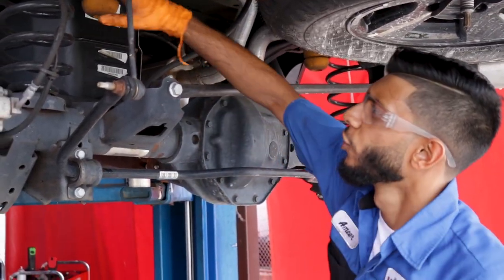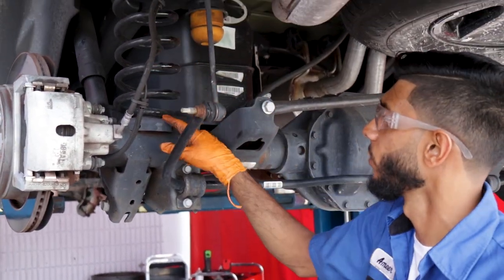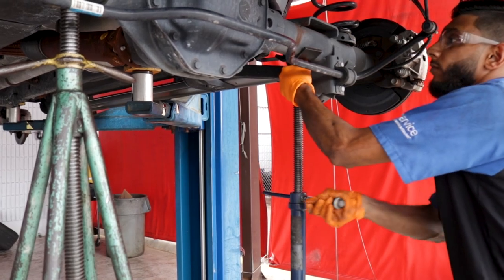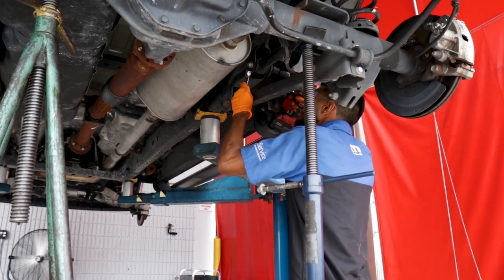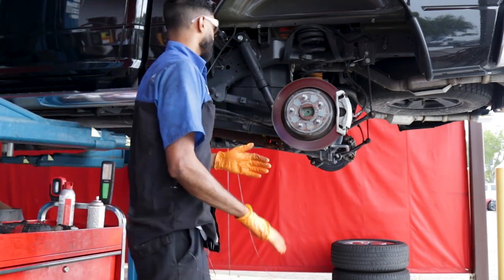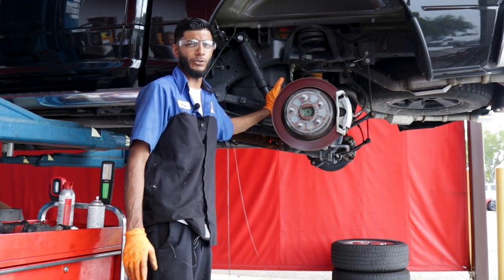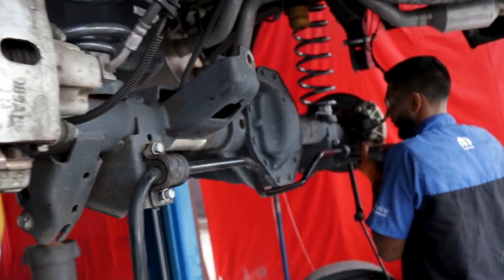We're going to lower the rear end, remove the springs, remove the shocks, and install the new shocks. We're going to set the new spring in there with the stopper — it's going to sit right on the bottom — and then just screw the pole jacks straight up. We're pulling down the fender liner to get access to the rear shocks and lower control arms. We're going to remove the shocks on both sides, support the rear axle, and loosen the control arm. You don't need to remove any bolts — you're literally just going to loosen and lower, and remove the track bar so we can add the track bar bracket.